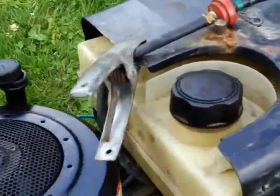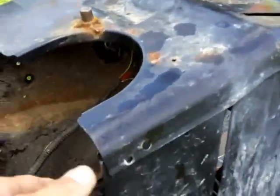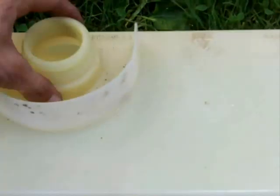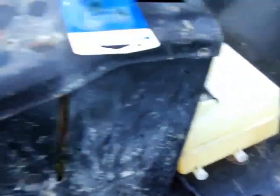While that's draining out, I'm going to pull this gas tank, clean it out, and do the gas line. On my Murray widebody here, it's just four Phillips head screws. The gas tank's off — I had to unbolt the top of the dashboard just to clear that engine and get it out, but that wasn't a big deal. Now that I've got the gas tank off, I can slosh it around and see the chunks of debris that exist in my fuel tank. Fuel tank's all clean inside too — I basically just hosed it out real good, held it upside down, blasted water into it in every position, dumped it all out, blew it out with an air compressor, and then put a shop vac nozzle down in there and sucked any remnants right out. It wasn't that hard. But there were pieces of wood chips and sediment and crap like crazy in there, so I'm glad I cleaned that out.